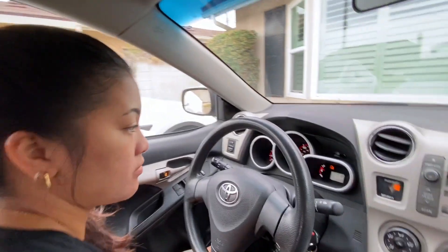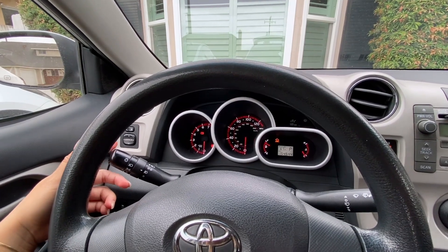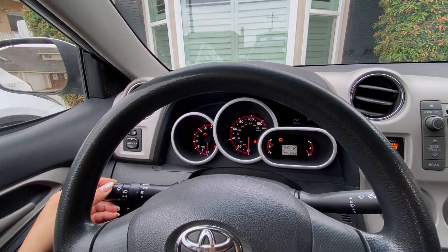Hello and welcome to Scott's Garage. Emily's back, and if you put on the right blinker it blinks kind of normally, but if you put on the left blinker it's blinking really fast. When you have a light that blinks fast like that — not in all cars but in this car and a lot of Toyotas and other Japanese cars — that's telling you that there's a problem and we should probably address it.